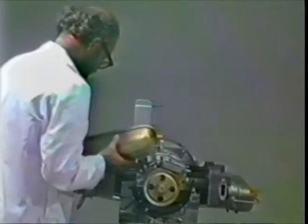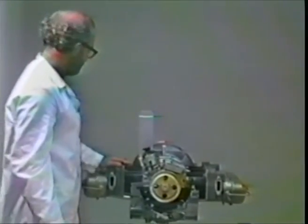Stick the valve cover in place, bring up the bail, tap it down a bit. Go over to the other side. Stick the valve cover on. Bring the bail up. Move it down a bit. You have just installed your valve covers. The engine is almost as pretty as it's going to be. We'll add the manifolds, the fuel pump, and the generator stand next. Show you how to put the distributor in properly and do everything else to it.